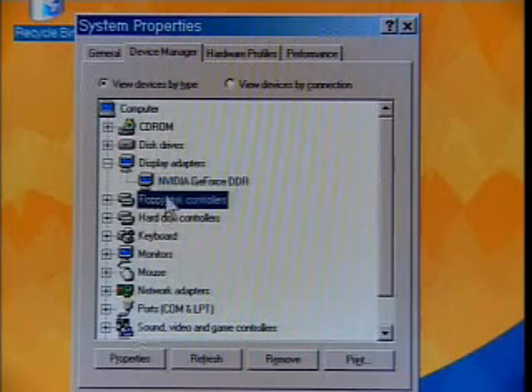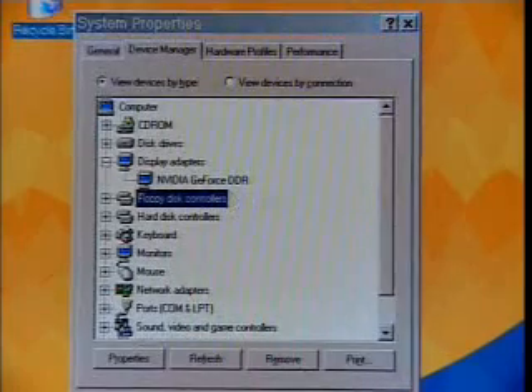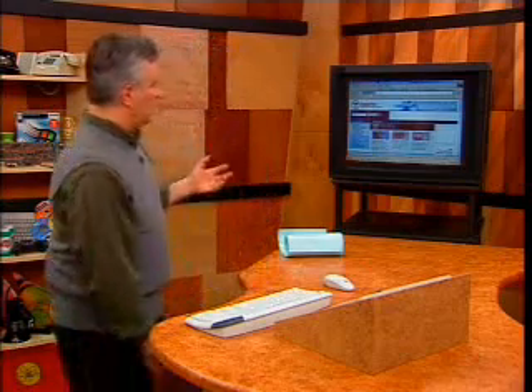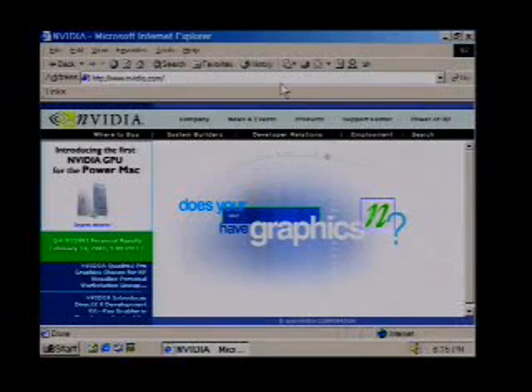In this case, I see I have an NVIDIA GeForce DDR, so I'm going to go to the NVIDIA site — which is simply NVIDIA.com — and make sure I have the latest version for that particular video card. If you bought your computer from Dell, you might go to the Dell site; they'll actually have a list of all the drivers for your particular hardware, because Dell and other companies sometimes customize the hardware for your computer. Do get the latest device drivers, and I'd recommend saving them onto a floppy so you have them for the future.